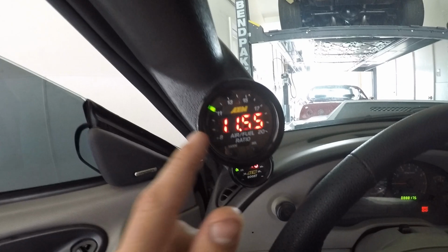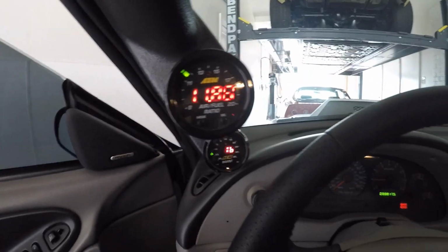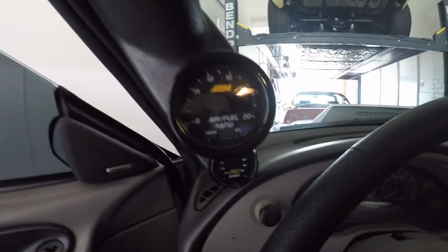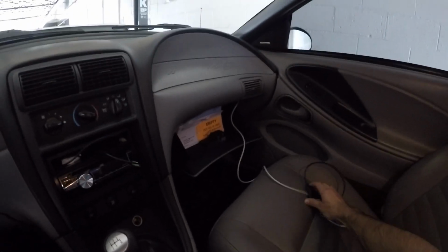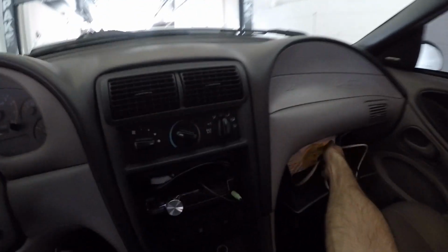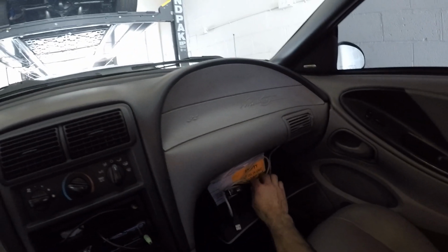Again, I want to get that better. If I can get that better, I'll be happy, because it is pig rich, and it burns your eyes and stuff, guys. That is progress, if you ask me. I still need to take it for a drive. I haven't really even driven it since I've been doing a lot of this idle tuning. I've literally just been sitting in the driveway, but I need to rescale the kPa, my fueling tables, ignition table, and AFR table. That all just needs to be recalibrated and rescaled.